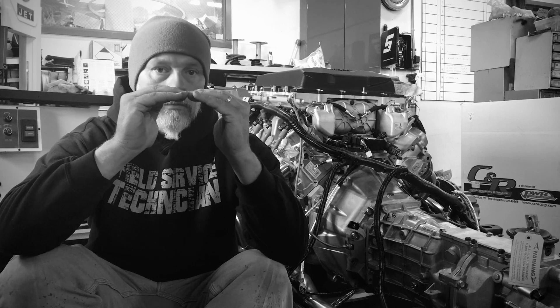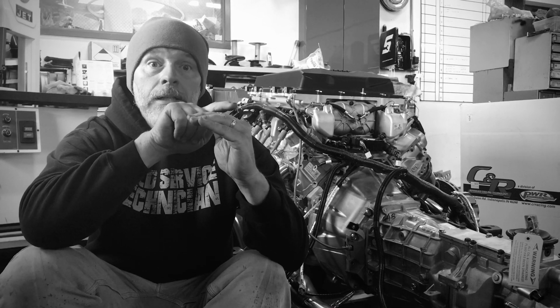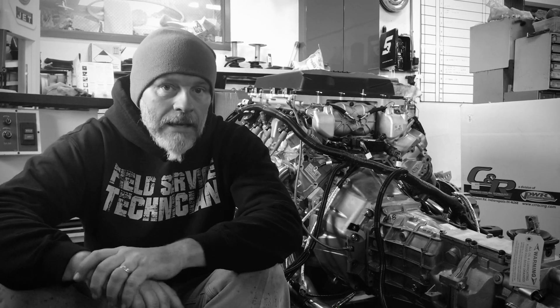Basically you're going to have a UTP 500, which is a very smooth ramp for a camshaft. And then there's going to be the X, which is an extreme energy lobe, which basically lifts the valve open quickly, holds it open longer, and then drops it off fast. But with the X cams, you're going to have to have a better valve spring to run that — and in our case, obviously we do.